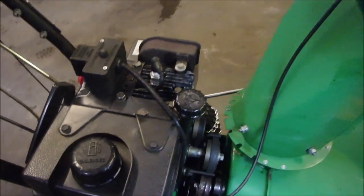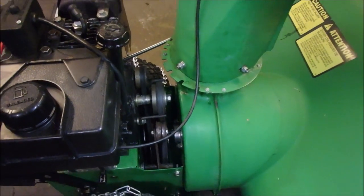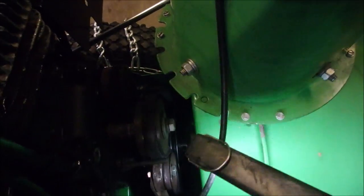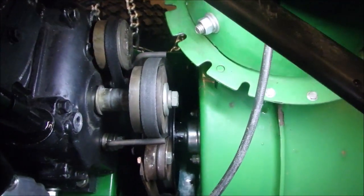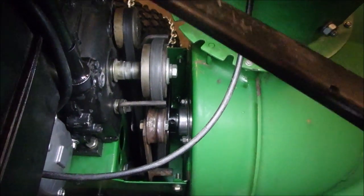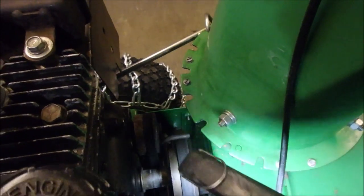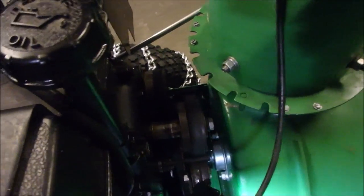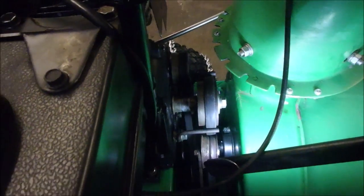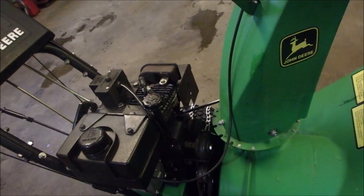So I'm ready for the next round, although it's pretty much done. You guys saw it, I hope. Okay, guys. Just one sec. So I'm happy with the placement of the pulley down there, the black one, right there. So I Loctited it in on the grub screws right there. You can see one of them. And I used Loctite, red Loctite. Now this idler pulley is a little bit off, but the actual pulley lines up dead center with the drive pulley down to the black pulley down there. So I noticed that the wear is on this side of the idler, same as it is now. So that's okay.